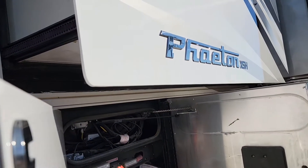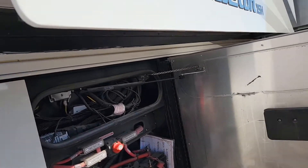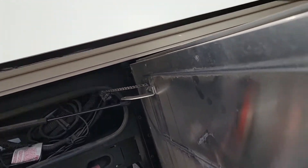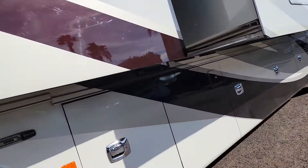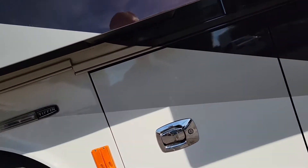There's also a disconnect switch on the other side where those batteries were, as well as the on/off switch for the inverter. You can turn the battery disconnect switch off when you're not using it so your batteries don't drain. I always turn those off because I don't want to kill batteries, especially brand new ones. Even with newer RVs that have disconnect switches front and back, you want to make sure those are off if the RV is sitting for a long period of time. You've got another storage container back here as well.